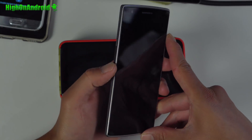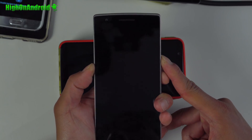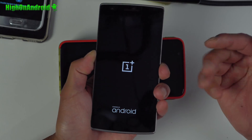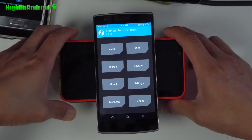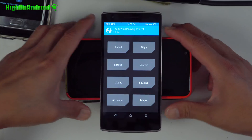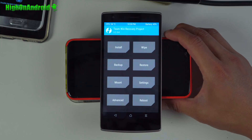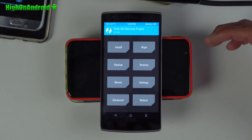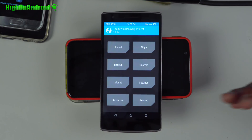Once your phone is powered off, hold down volume down and the power key. Volume down and power — wait till you see the logo, then let go of the power button but keep holding volume down. Within a few seconds you will enter TWRP recovery. If you don't see TWRP recovery at this point, you may have to reinstall it using fastboot, or if you're rooted you can use the Flashify app to install TWRP recovery without a computer. You should see version 3.2.3 — any version 3.0 and higher you should be okay. If you're on an older version, make sure you're not on 2.8 or 2.9, because then you won't be able to install the ROM.